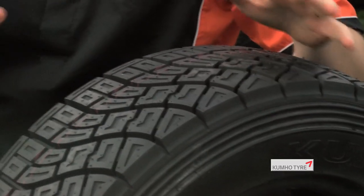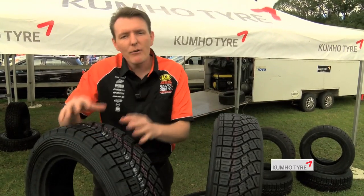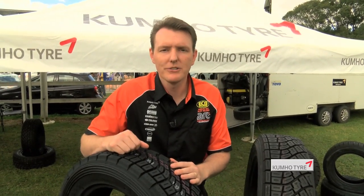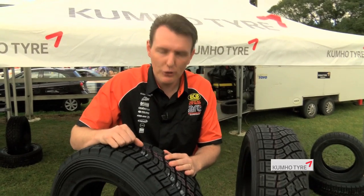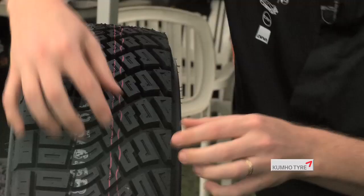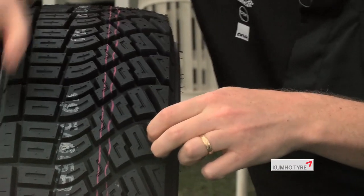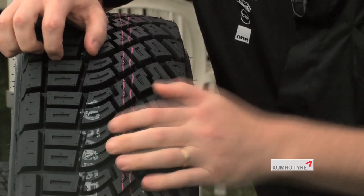The main difference is the construction of the blocks. The R800 is designed to try and take advantage of the first pass or the first run through wet conditions. It's trying to fight through the top layer surface and get down to the grip below. You can see there's quite a bit of a gap between the blocks — if I even turn them there they squirm quite nicely, trying to bite down and take advantage of that.